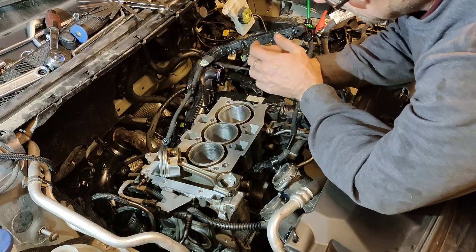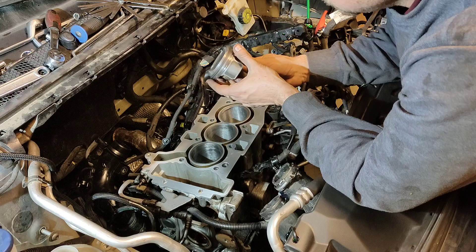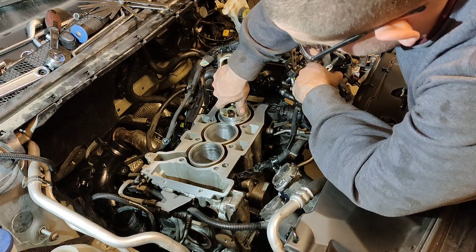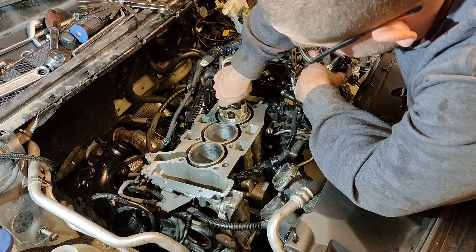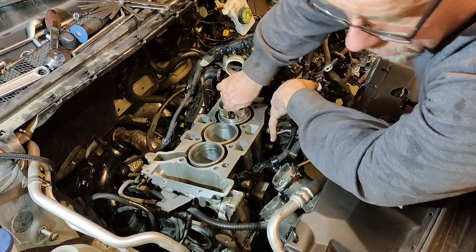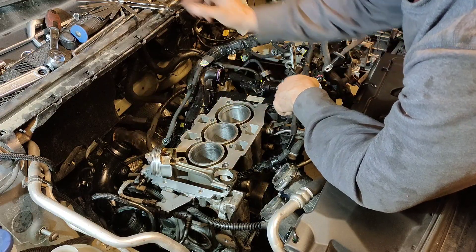Put the ring in — you want it to be flush and level. Take another piston with the rings installed and just set it down, push until it doesn't go any further because its rings will stop it. Now this ring is completely level and flat.